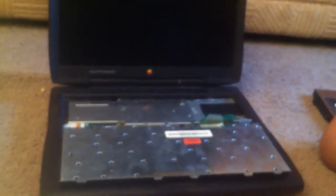Now a couple of you are probably wondering how do you put it back on? Well, it's pretty easy. You take it, bring it down, and all these tabs go into a little slot specifically for each one. You need to make sure it's all lined up in the slots and push it in there. Then push down right there — it'll click on that side. Then push down on this side and it'll click on that side, and then the keyboard is all back on.